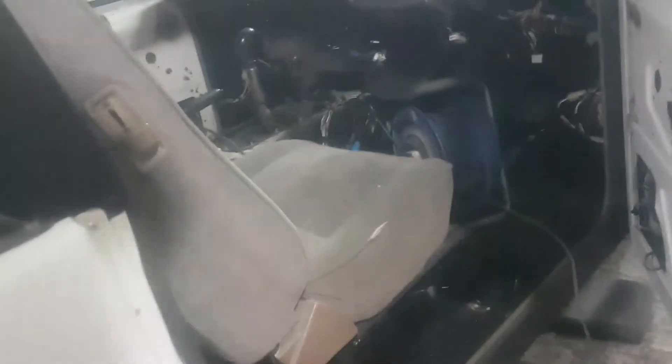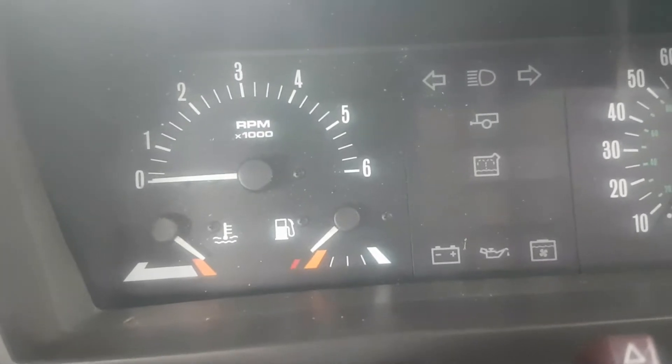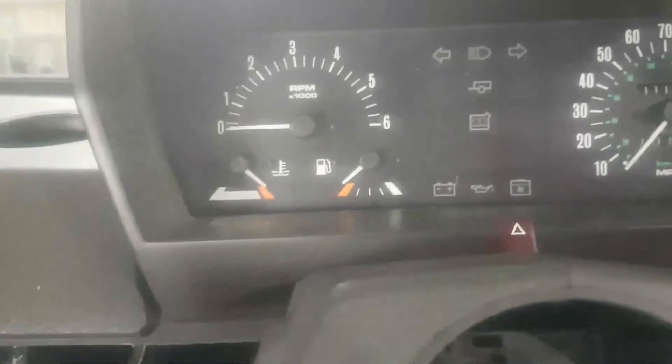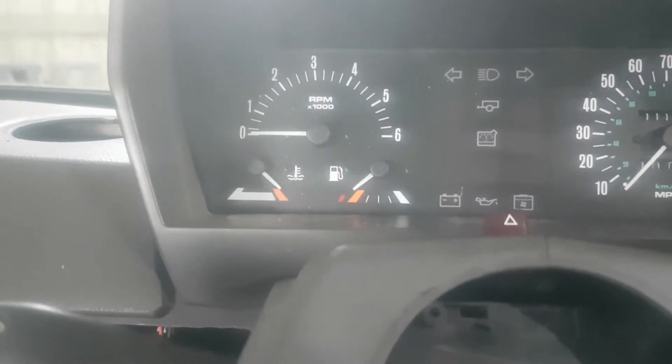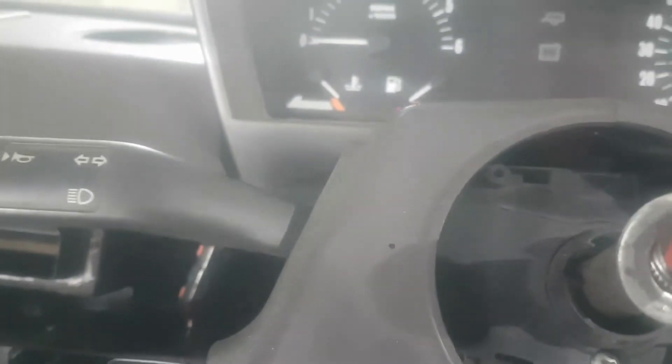Nice bit of Turin dot there just for shits and giggles. I think that's six o'clock — I'm done until tomorrow. I'm going to do a full electrical check tomorrow. Where are we? First and foremost, the original dash dimmer is knackered, so I've got another one. Lights go on, there's no noise, but there's no lights on in the interior either. The noise at the back was coming from the rear wiper motor. When I plug this in, you'll notice the temperature gauge maxes out and the fuel light comes on, as do the lights. But as I use the dimmer it's dimming all sorts of weird things — there's a cross somewhere in the circuit and I'm going to have to go through and double-check where these crosses are occurring.